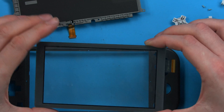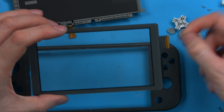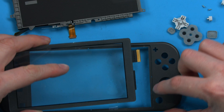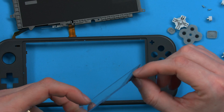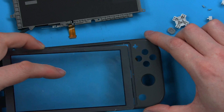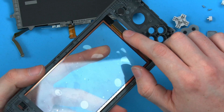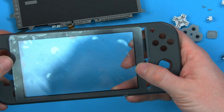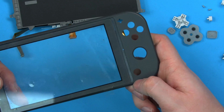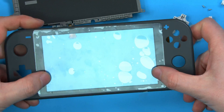Starting with the new touchscreen, all we have to do is get this board upright in the way you'd look at it, with the ribbon on the right side, and you'll see this little PCB ribbon here. This bit slides under this plastic rib, and in between those two bits is where the plastic actually sits. From this side you'd see this ribbon going underneath, this ribbon will also go underneath, and if we slide in and watch for this little black ribbon going under the plastic — like so — gently push in and down, and that's in position.